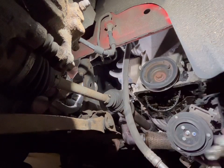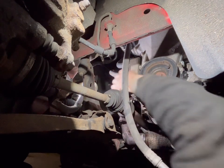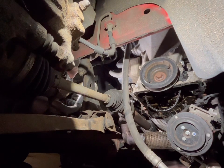And there is the knock sensor — that's out the way. Last but not least, we need to remove the starter motor. So we've got this little clip here, a 13mm there, 10mm there — get those two off — and there's a 10mm at the bottom. Then a 10mm or 13mm at the top, so I'll get my sockets. Might need a deep 13 actually, but we'll give it a go.